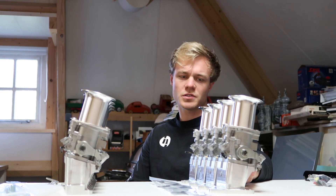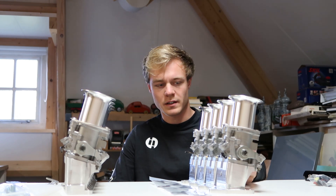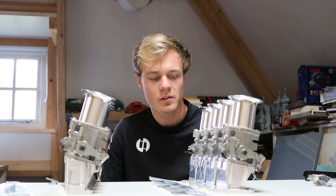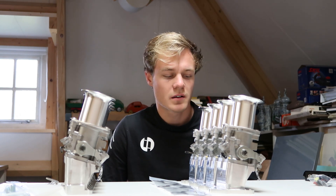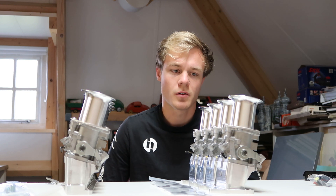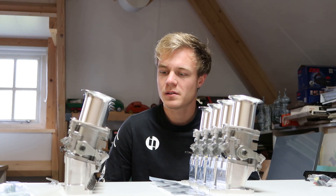I'm not really going to install it — I'm just going to show you how it's mounted on my car and go over the requirements for this ITB kit. One thing I really want to show in depth is synchronizing the throttle bodies. A lot of misconceptions about ITB kits come from that — bad idle, bad starting — and those can really be ruled out by synchronizing them properly. You just need the right tools and then it's not that hard. It's pretty satisfying and definitely worth it.